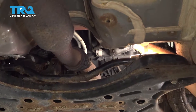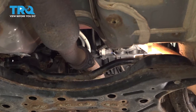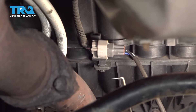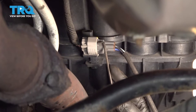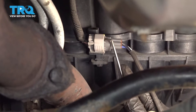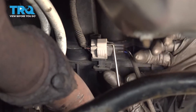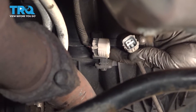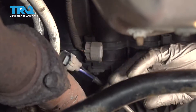On this, you're going to find that you have a gray squeeze tab over towards the driver's side of the connector. Generally, you can just go ahead and squeeze on that and separate the two pieces. Now if you have a hard time getting up in there and squeezing that while pulling, you can also continue on with a pick. We'll come along the passenger side and carefully get underneath the locking ear. Once I have that popped up and out of its position, I'll continue on by separating the two wiring harnesses. Every time you disconnect an electrical connector, take a peek — if you see any funny colors, it's corrosion, and that would need to be dealt with.